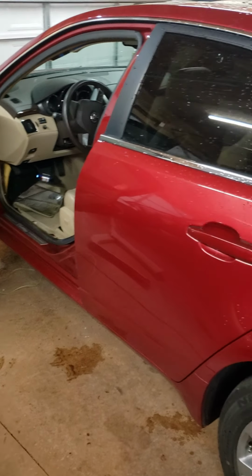So there is an easier way to get to that drain tube, and that is right through here. There is another piece of insulation that you can see. It does have a wiring harness that is kind of right here in the way, but it does slide right off of that screw, and you can get your hand back in there. Now, for this video, I did pull this drain tube back out just to show you where my problem was.